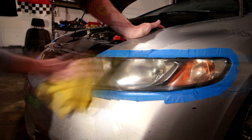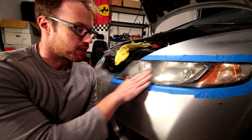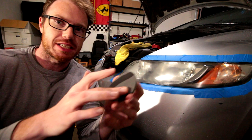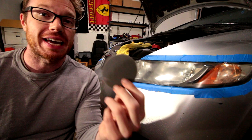Looking at this now after doing the wet sanding, you'd almost think we've gone backwards — they look hazy again. But this is actually what you're after. The surface looks really hazy because of all the sanding marks, but it is exceptionally smooth, which means we're on to the next step. That next step is the 3000 grit sandpaper. Running your finger across this, it is so gentle — it's more like a finishing pad. You could almost wet sand your paintwork with this stuff to get imperfections out. That's how soft it is.